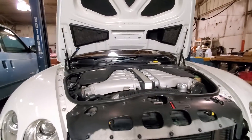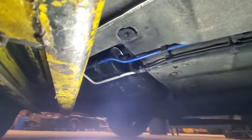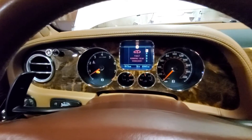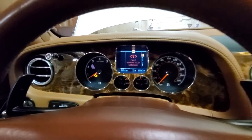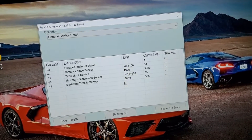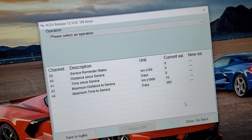She's back running — let's check underneath and see if we have any leaks. Everything looks nice and dry, no issues. Back here at our fuel filter, no issues either. Starting this thing out without fuel pressure because we removed the fuel filter threw a check engine light with a running gear fault, but that's no big deal. We're going to hook up our laptop anyway to clear the maintenance minder. With VCDS open, we can go ahead and reset all of our service reminders and that'll give us a clean slate. Everything is reset.